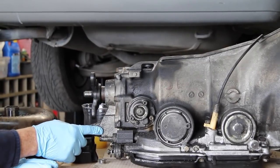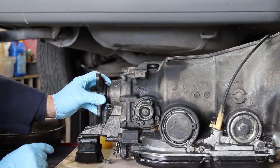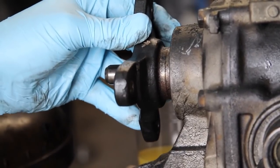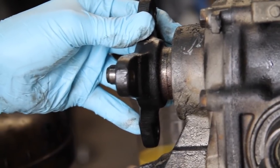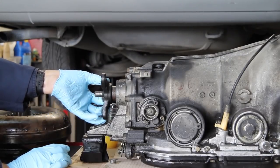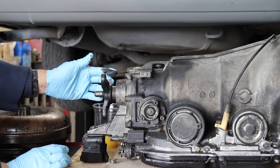Look at here — you can see the wetness right in this area. When I started looking closely at the seal, I grabbed ahold of this output shaft and noticed: I've got some movement here. This thing is loose. That's a problem. You can actually wear out the spline on the output shaft if this loosens up and is rattling like this. We're going to have to take that nut off and check the spline and re-tighten this, so I'm going to go ahead and plan to replace this rear seal at this time.